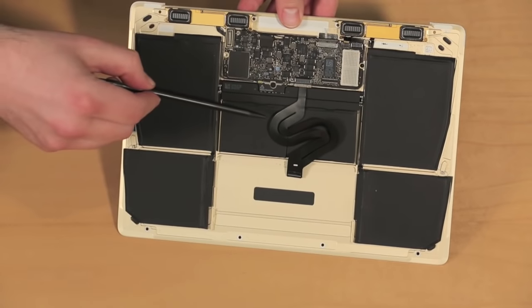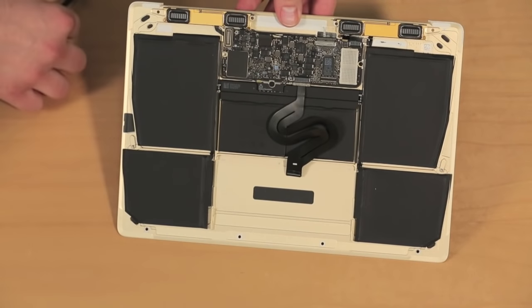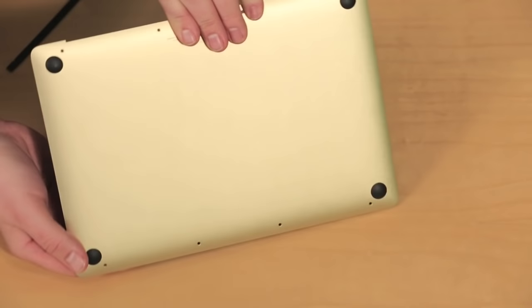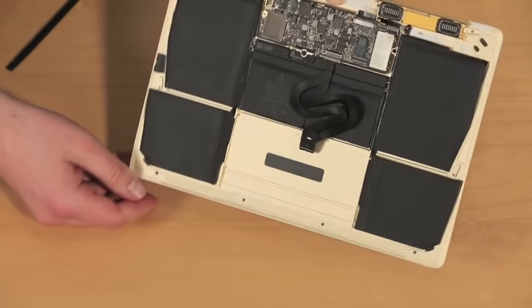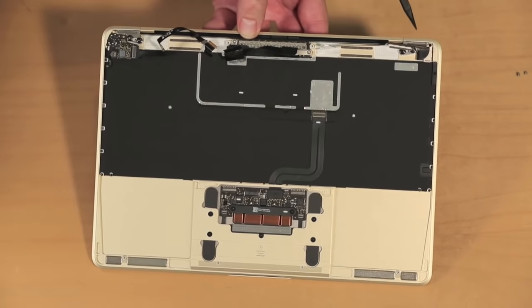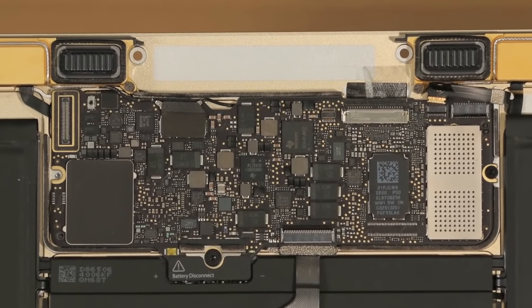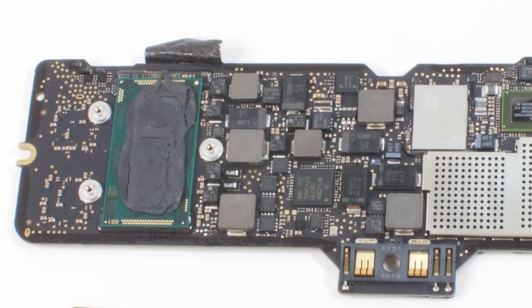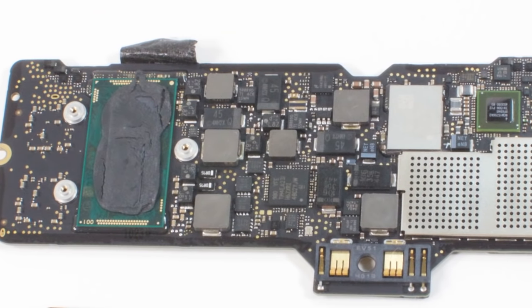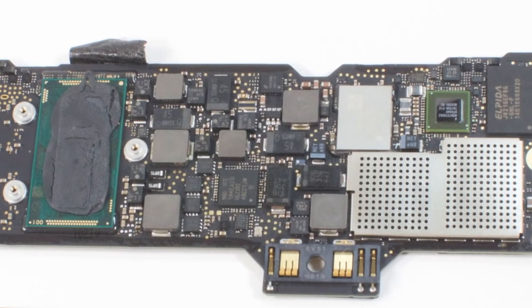We can really see just how different the new MacBook's internal design is from the MacBook Pro and the Air. For starters, the battery, main logic board, and the speaker and antenna assemblies are all attached to the case's removable bottom panel, not the upper half, which houses the keyboard, trackpad, and ports. The new logic board is significantly smaller than those on the Pro or the Air, and thanks to the new Intel Core M processor, gone are the familiar fan and cooling assembly.